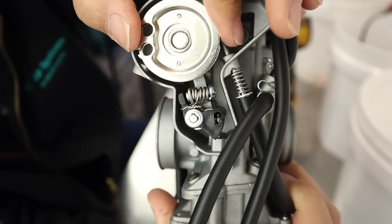We're doing pretty good. Before I ride, I recommend checking whether you guys have that wire-tie mod done behind your carburetor's plastic door — JR did it for me before he sent the carb, and I don't know if the production model came that way. Right now the plunger rod slack I was showing earlier isn't really affecting anything — I've got good roll-on power and it revs all the way through the RPM range with stock jetting. That might be something you can do to get to this point, which is really really good. I'm really excited to ride this — let's take this pig out.